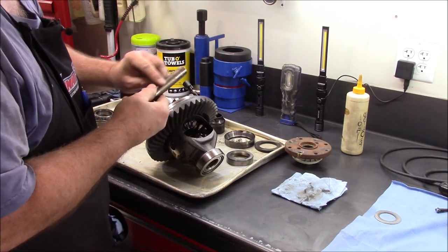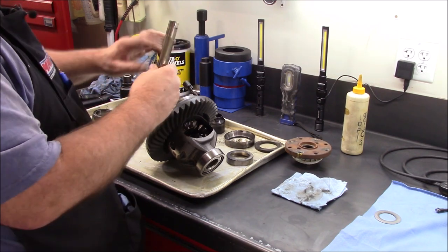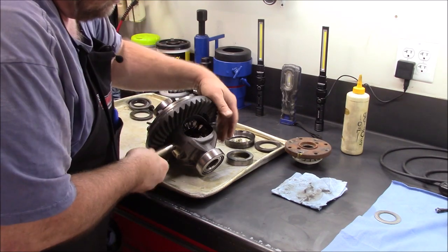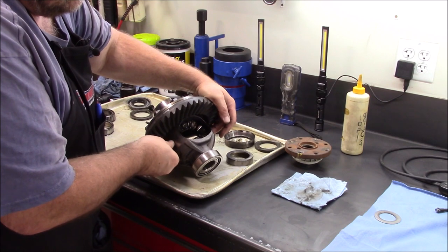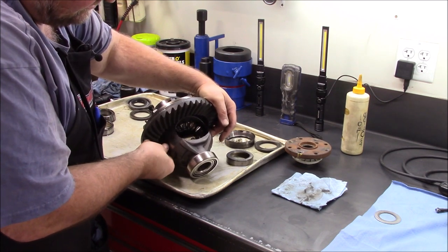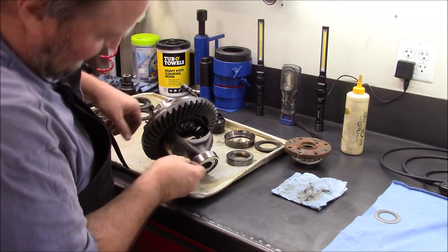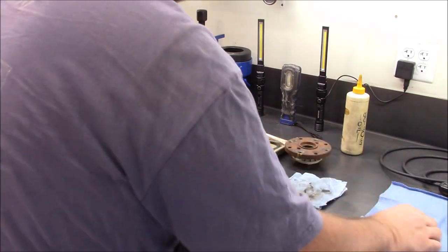Another thing — while you've got your pins out, check them for wear. This one has a couple of marks from the axle shaft because this sits right in between the axle shafts. You can see them but you can't feel them with your fingernail. Just double check those, and you can double check and make sure you've got the spider gears lined up. You could even leave the pin in place while you assembled it so they wouldn't fall out — just thread the bolt in a couple threads.